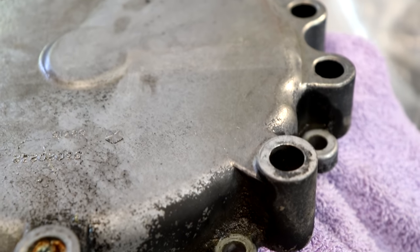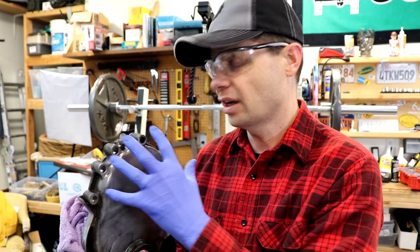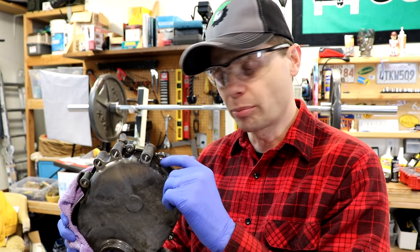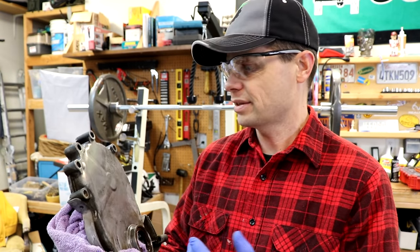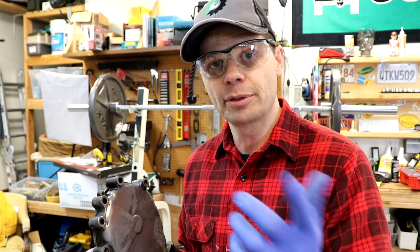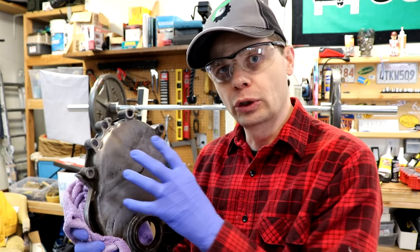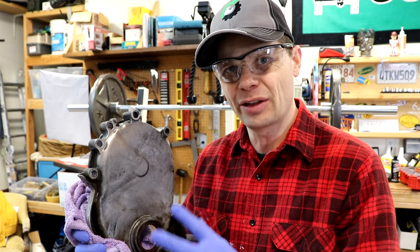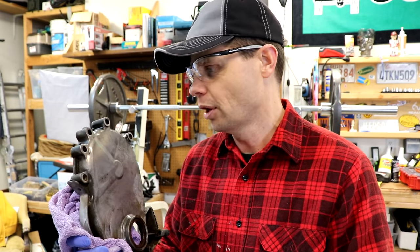And remember, this is after this has been soaked in a parts cleaner overnight, and it still had all this caked-on oil that I scrubbed with a brush and couldn't get off. So this Purple Power works best as far as what I've found. Let's check this out on the intake manifold — let me show you how that worked. It came out really good as well. There's no other miracle aluminum-safe parts cleaner out there that I know of, so this Purple Power does the job for me. I'll link it in the description below.